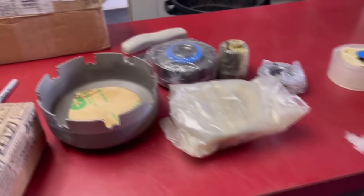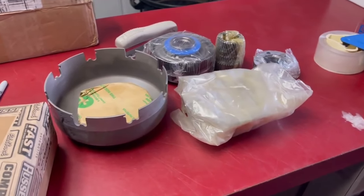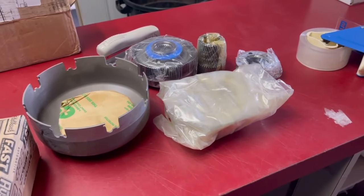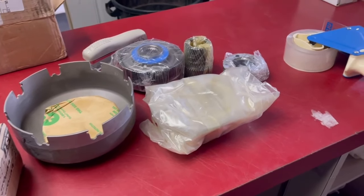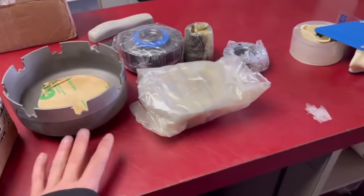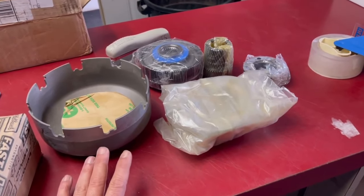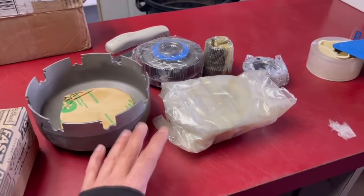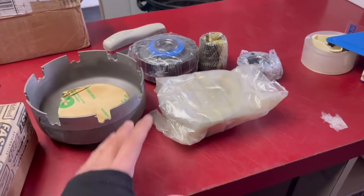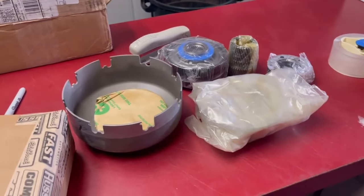It lowers the first and second gear ratio and keeps the third 1-to-1. So it's going from a first gear ratio that used to be 2.45-to-1, now it's 2.71-to-1. And the second gear was 1.45 and now it's 1.54. Mind you, I do have the 4.30 gears in there now with the original C6 stuff, and I had a pretty good launch with no brake, off the actual foot brake. But I'll be going with this kit, which has much lower first and second gear, with the trans brake and the two-step, and instead of the 4.30s, I'll have 4.8s with a spool.